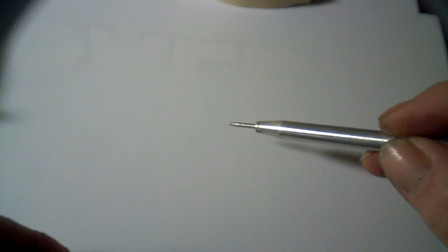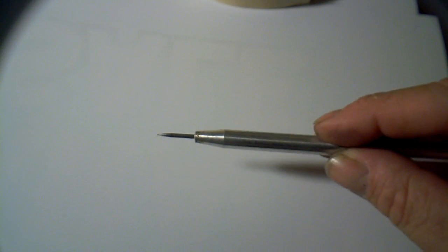So when you peel it off, even though the paint is on really thin, you still could have a pretty good ridge. So it does matter how thin the tape is. You can't fix it by just spraying it really thin. You can help it some, but it really doesn't cure that problem, okay? And you'll end up having to spray a lot more clear coat to reduce that ridge. Now, of course, you can sand it and knock it down, but when you're dealing with the Createx paints, you can't do that, and that's another big reason that I'm doing this video, okay?